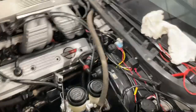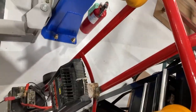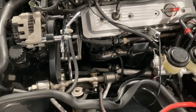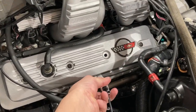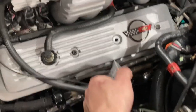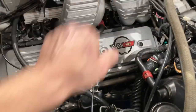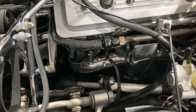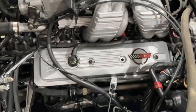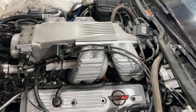That's the timing on this particular car. I don't even have a battery in it — I run it off a dolly system with a tractor battery that'll start anything. Where you hook your timing light up is to your number one wire. Your plug wires may not be stock on your car, but this is factory. The top one is your number one wire. Your number one cylinder is on the driver's side — it's 1-3-5-7 on the driver's side and 2-4-6-8 on the passenger side. Your firing order is 1-8-4-3-6-5-7-2.